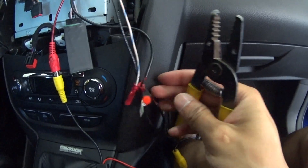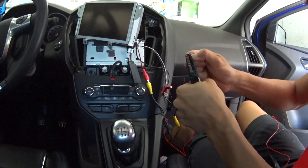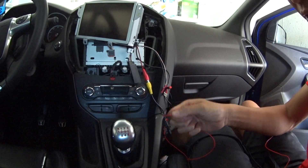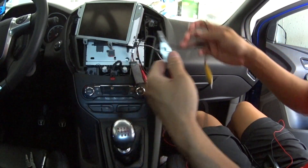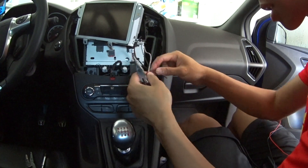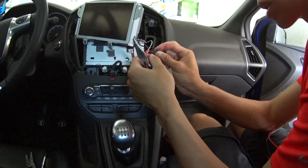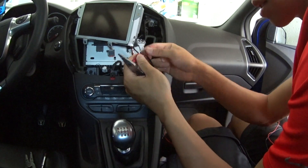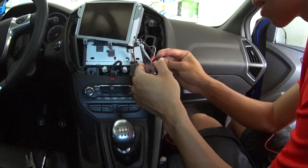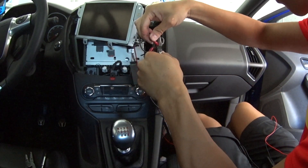What I do is put the wire in, make sure it's the right size, twist it around a little bit, pull on the opposite side, and it comes right off. This was the old camera — cutting that off, no big deal. Old camera's not working anyway. I'm going to cut the rest of these because there's plenty of wire. I just need to make sure I know what's hooked up to what: white to red, and black to black. I want to cut it as far as I can to give myself some leeway if I screw up.